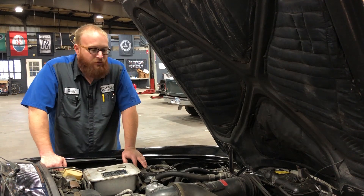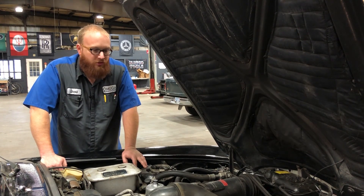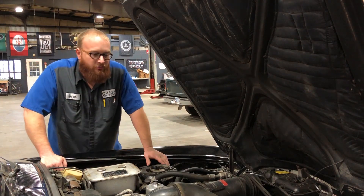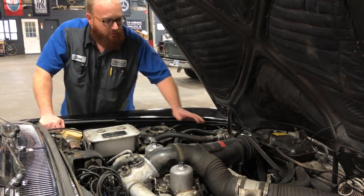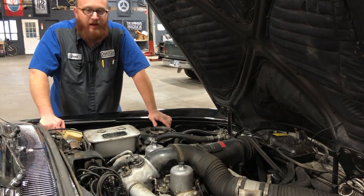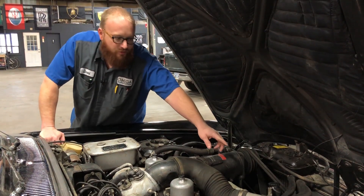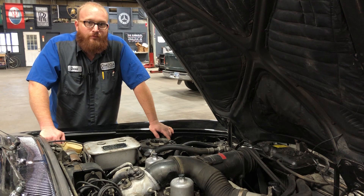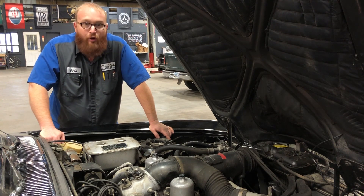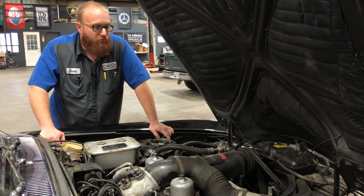This is the venerable 6.75-liter Rolls-Royce V8 — basically a tank of an engine, it just goes and goes. But there are some quirks. This is a British engine with British SU carburetors, but the air conditioning is General Motors — an A6 compressor you'd find on Cadillacs, Buicks, and Oldsmobiles in the 70s. It also has Saginaw General Motors power steering and a GM Turbo 400 transmission. There are quite a lot of things on this car that are not British. One might think everything is special and rare, but there are actually a lot of everyday GM parts on this car.